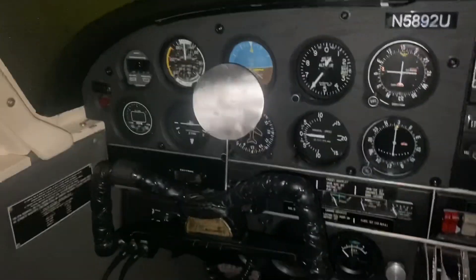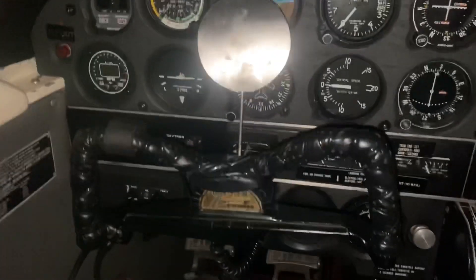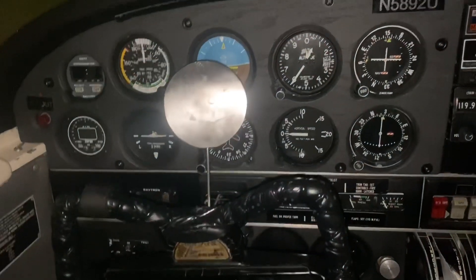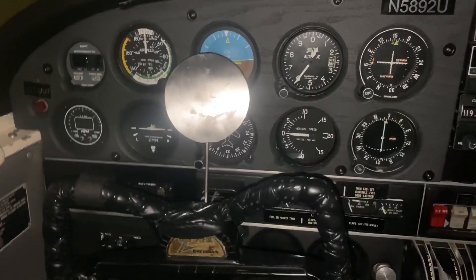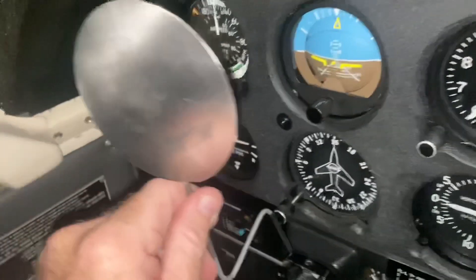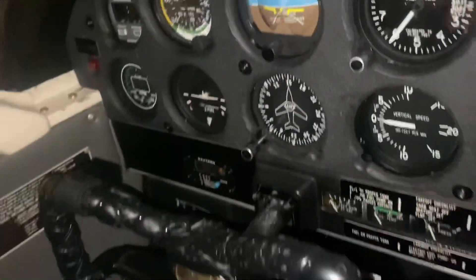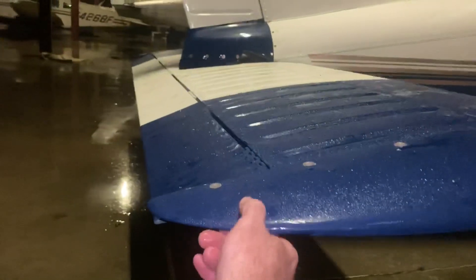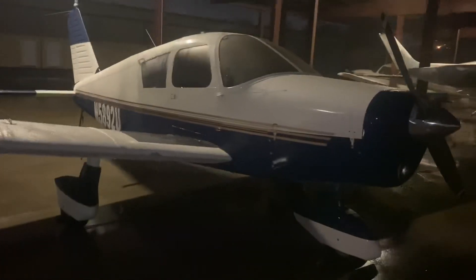You're really going to want to take that thing off prior to pre-flight. Anyway, that's what I've come up with — I love it. I think it's going to do exactly what I want. This is a rough draft; it's made out of steel and I'm going to make it a little cleaner and nicer. I put shrink tubing on it to try to protect it from scratches. It's locked down, not moving at all. On the aileron we get maybe three-quarters of an inch of deflection either way, but that's plenty to keep it from getting slammed around too bad.